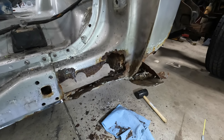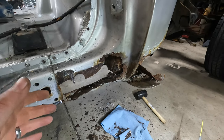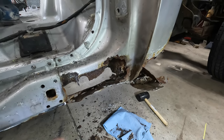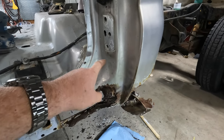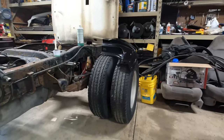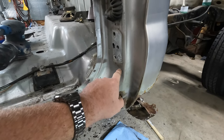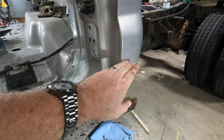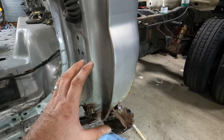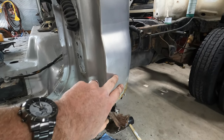What we're going to do today is a little bit of a shortcut. We're going to cut out the corner of this cab corner and put a new one in place. We're going to do a hybrid glue and weld — using a 3M product designed to glue panels on, and a little bit of welding as well. We want to leave the hinge placement intact. Our cab corner sitting over there on a tire is a complete cab corner, but we don't want to replace the complete cab corner because I really don't want to affect this area too much. So we're going to cut down here around the bottom underneath the hinge, come around and wrap it around the back side, and flush mount this whole corner piece. We're going to overlap the outside and glue it on top.